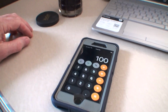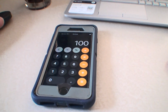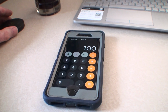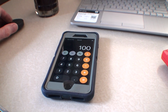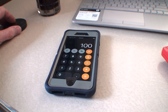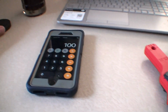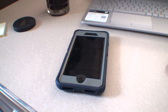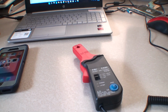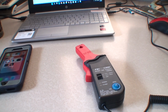Now, the reason this matters is that the more modern cars with a computer, they're always drawing some amperage. Supposedly it's in the books, but I don't know where it is. But like what I read, between 25 and 50 could be normal. I've got two cars I'm going to be working on, the Trans Am and the Ranger. The Trans Am shouldn't be pulling any amperage, at least I don't think so. But the Ranger could be pulling 25 to 50. It depends. In other words, you've heard them say, don't disconnect your battery because everything will go dead.